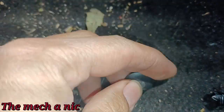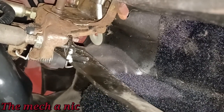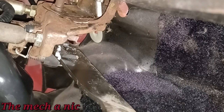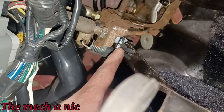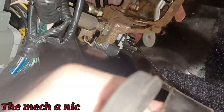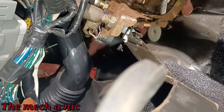I was able to get the easy one out — it came out in two pieces, which is fine. With that piece out of the way, you can see the plunger for the switch has nothing to press it now — it goes all the way through the pedal. That's why you need these little plastic buttons. The new part fit in there perfectly. Look, there it goes — you can see it working. It just popped in, had nice tension on it and feels solid.